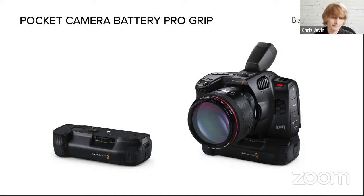This allows for hot swapping. So it basically means that you won't ever have to remove that internal battery. You can just be hot swapping those ones in the sled. Make sure, obviously, the battery in the grip is fully charged, and you can just hot swap those sled batteries out. And as soon as those new ones are in, again, that intelligent technology will know to drain those sled batteries before the internal battery.